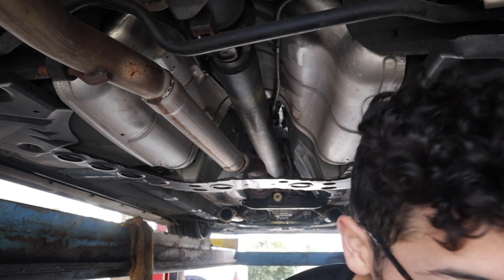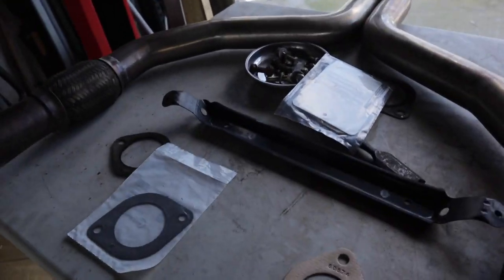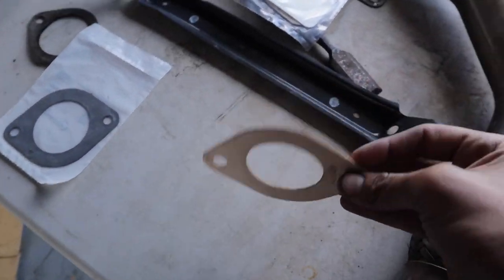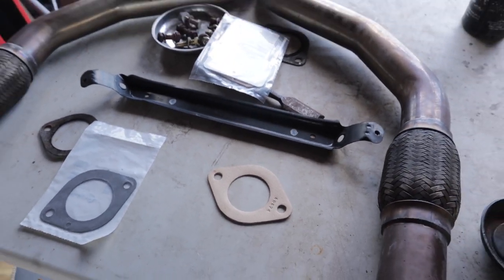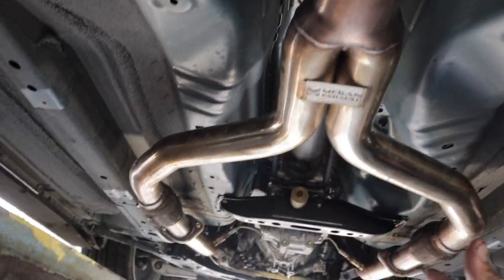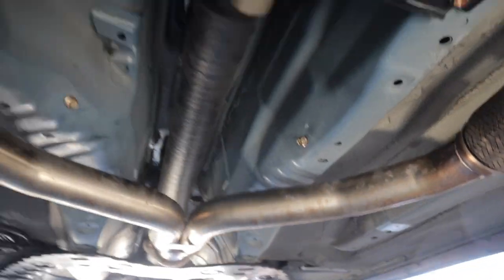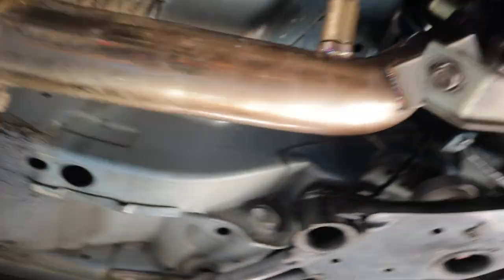Got the 17-millimeter bolts and nuts — driveshaft is on, everything is nice and tightened up. Now I'm ready to put the Y-pipe on. I've got all my gaskets and already showed you the part numbers — pretty straightforward, just put it on the way you took it off. The Y-pipe is fully on, completely bolted up and tightened. Tying up the bolts for the test pipe support that go to the transmission — everything on the bottom is nice and solid.